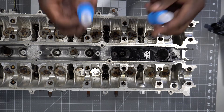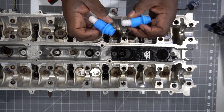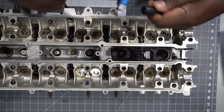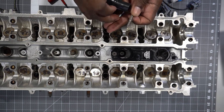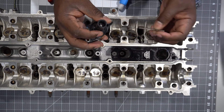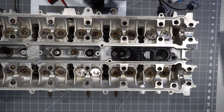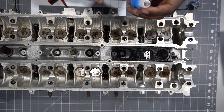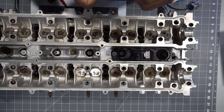The kit includes a set of shorter stalks. We went over the design benefits beyond just the physical height requirement. Take the factory coil and twist to remove the plastic boot. Make sure you keep the fusible link — be prepared that there is one in there so it doesn't fall down into the head. Do this on the bench where it's easy to locate if it drops. Drop the spring down into the stalk — the spring will protrude through — then take the assembly, barbed end first, pop it back into place, and twist with some force until it comes back together.